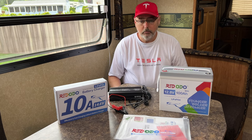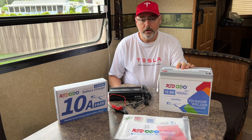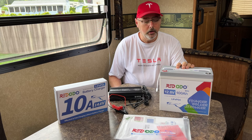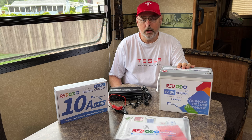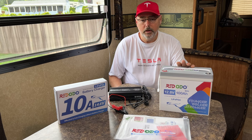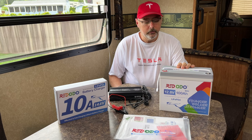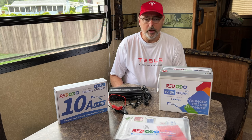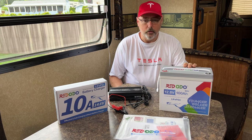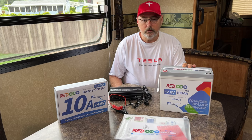I'm going to put this back in my trailer and set it all up. This battery ran flawless on the capacity test — it exceeded the capacity. I got between 101 and 102 amp hours, and when I stopped the test it was still above 10.8 volts, so there was still battery remaining. I just needed to reach the 100 amp hour mark, and it met capacity — I'm really happy with it.